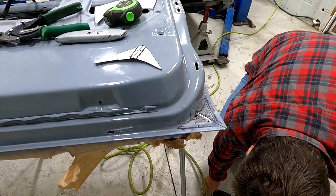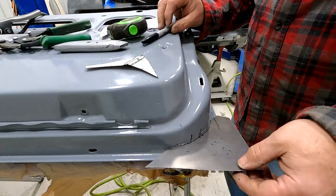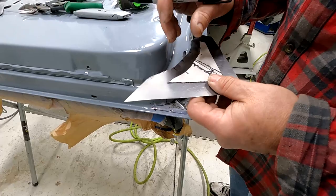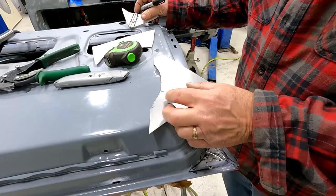So now we've got that laid out. Just cut this — and that fits fairly good around there. Let's take some lacquer thinner and clean that off so we start with a clean piece. We can transfer those two lines we just put on here — those are our guidelines, and this is our center point. We can do the same thing with this, transfer that, and that gives us the angle. Right here's our angle.